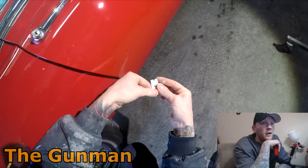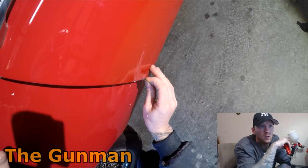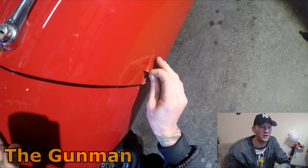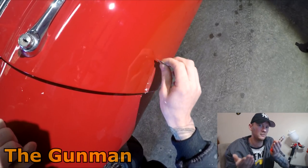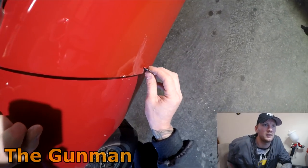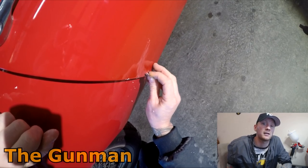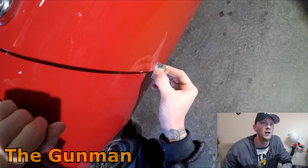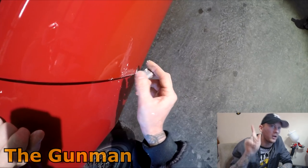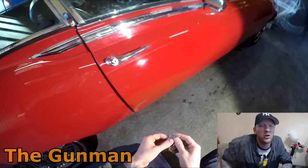There's another method for removing large runs — using fine filler, body filler. You can wipe some fine filler over your run, then block that out, and what that basically does is protect either side of that run from getting sanded when you're doing the sanding stage. We've got another video or two on that — how to fix paint defects — that's probably a more in-depth version of how to use that fine filler trick. I might even put a link to that in this video in a card, which is that little eye icon up the top.